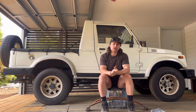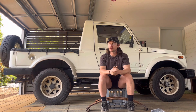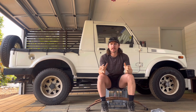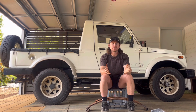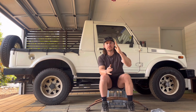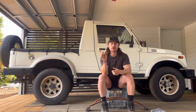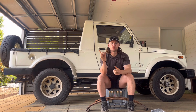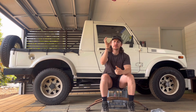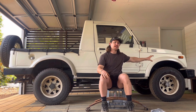So yeah, you can go about that a few ways. It all depends on the purpose of the car. If you want to mainly go off-roading and you want lots of flex, yeah, go for it. If you want a stable ride on the road, try and keep that shackle approach as nice as you can. With the fatty outside, the Suzuki you guys have probably seen, I've done the full rears up front conversion. I've shifted this perch all the way back 40mm, and I've done the chassis extension at the front.